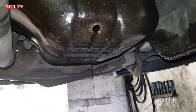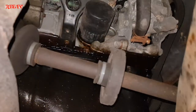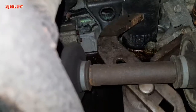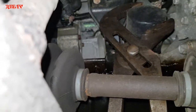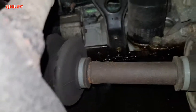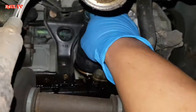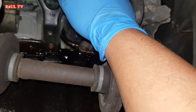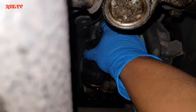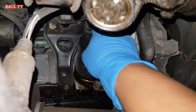Right, since that is draining out here, the oil filter is up there. So while that's draining, you might as well get the big dogs, a big clamp, and take the oil filter off. Let's go. Big clamps onto the oil filter. That's cracked. Get your hands on that. It should be hand tight. That needs an oil change, this car. Never ever been changed, I think.